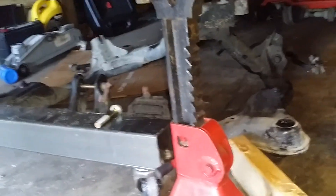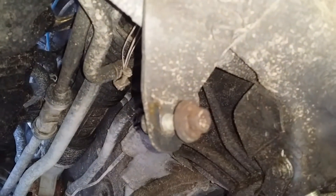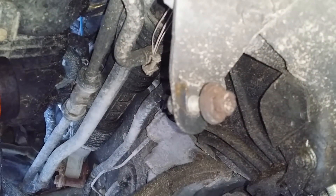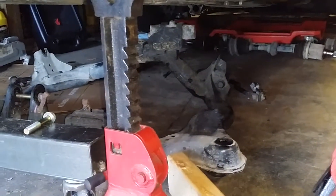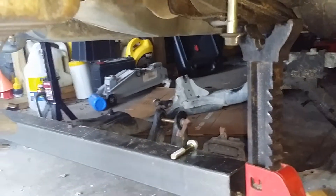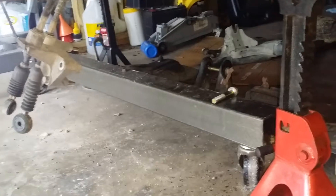That was a pain. It didn't mention anything about that screw right there, and on the other side it seemed to be holding it up, but I'm not really sure. I took them off anyway. I took the bolts out all the way and then put them back in like maybe two turns — all of them — so that one subframe disconnected. It fell on the bolts and I used the jack stands, kind of walked it down in three different spots. It looked a lot heavier than what it was.